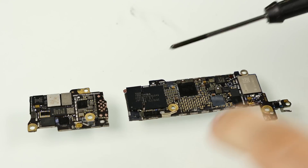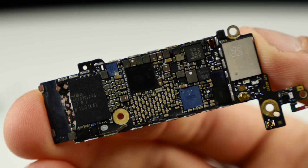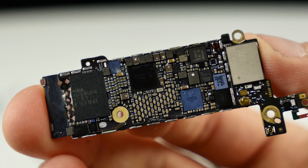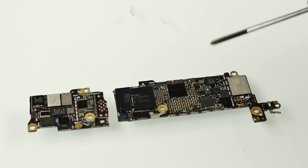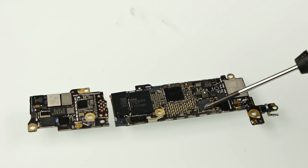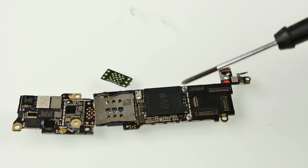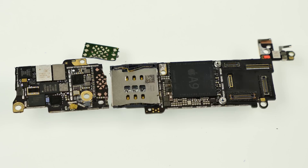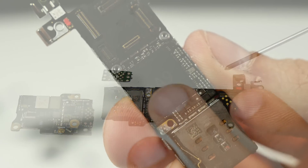Here's the logic board. It actually broke into two parts — like a puzzle. We can even see about 30% of the eMMC storage chip. The iPhone uses a Toshiba eMMC — 16 gigabytes of storage in that chip. Here we have the Wi-Fi module — that big one — and also the NFC chip, the charging IC, and down there the audio IC. The motherboard is pretty small. On the back side, next to the nano SIM card tray, we have the Apple A9 dual-core processor.